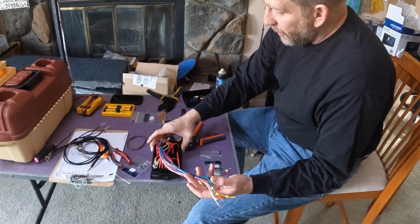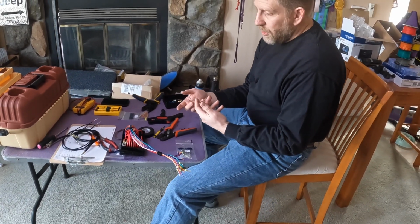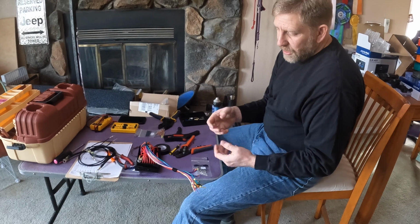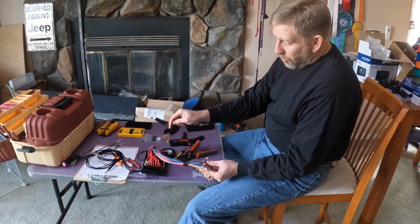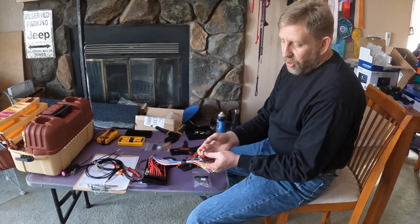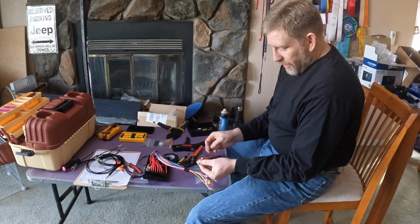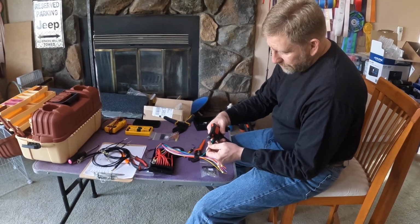We will do the same thing with the trigger wires for the relays as well. That'll all come out into one big, nice 16-way connector that we can disconnect and put together. It's going to be more of the same process of plugging all the wires into the box, adding the terminals, and eventually plugging all of them into the connector. So just lather, rinse, repeat. Keep doing it for every wire in the bundle.